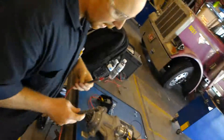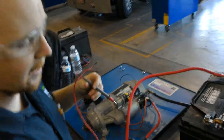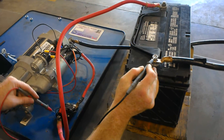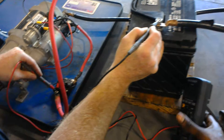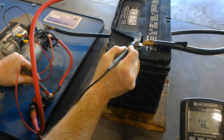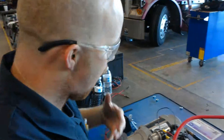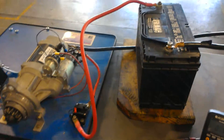The next thing we want to do is make sure the fuse is not blown and it's working properly. So we're going to test from negative to positive on this fuse to make sure we have proper voltage there as well. And again, we have 12.5 volts on that side, 12.5 volts on both sides. So we know our battery is good and we know our circuit is good and it works properly as well.